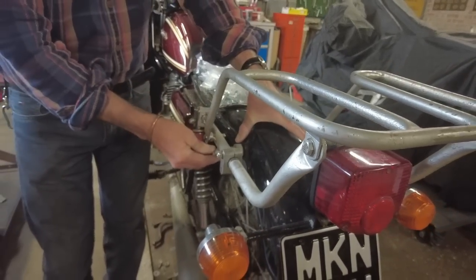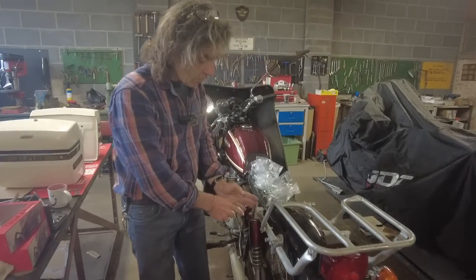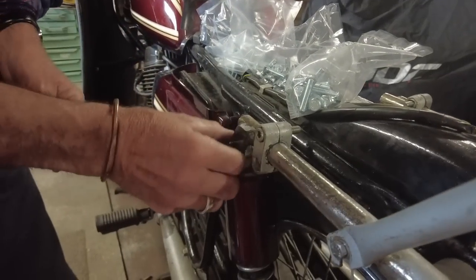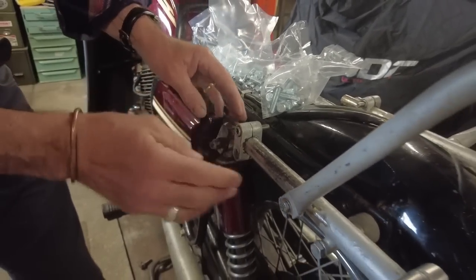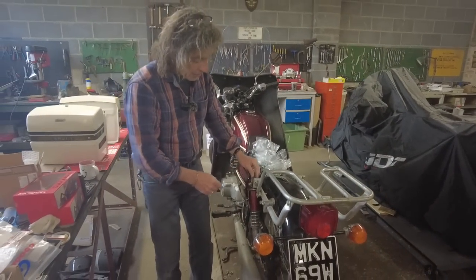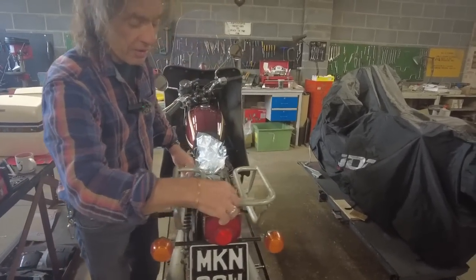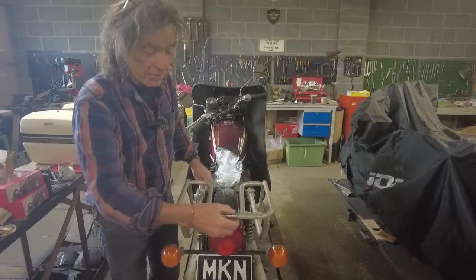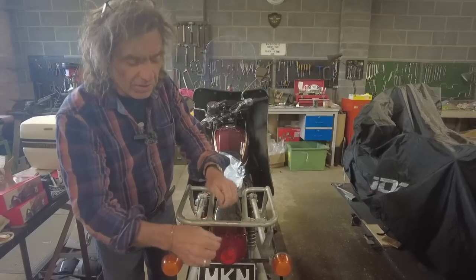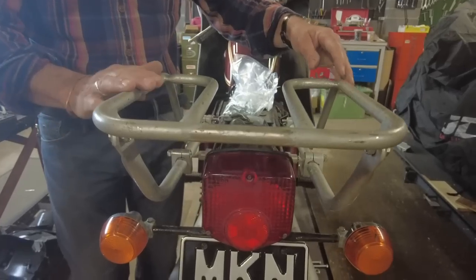So that's really sturdy. It's on the main frame of the motorcycle. And then obviously this end needs to go to the top of the shocks. So all I had to do was shorten this, and I've got my mate Jay down the way here, to weld on these tabs. So it doesn't look very pretty at the moment. This will be powder coated black when we're all done and dusted and I know it all fits. So I've welded tabs on, used that mount, and I sliced it here and then cut 60 mil out, braced it inside with a bit of solid bar, and then Jay welded up. It still needs a little bit of linishing in that, but you can see I'm really happy with the width of that. It's kind of in keeping with the bike.